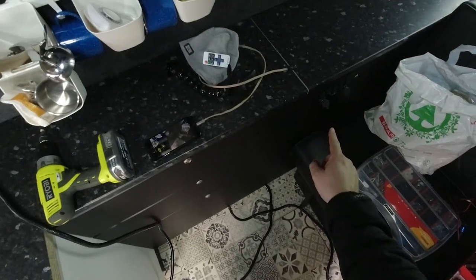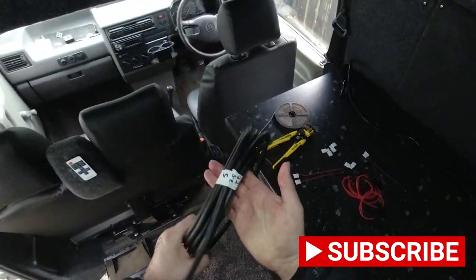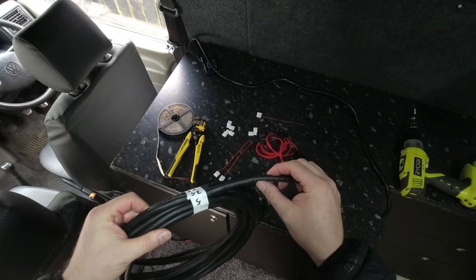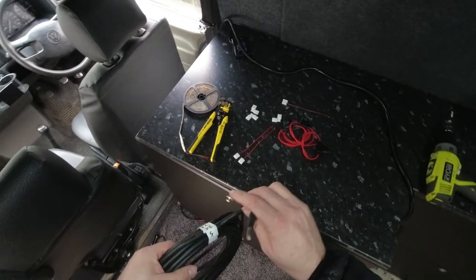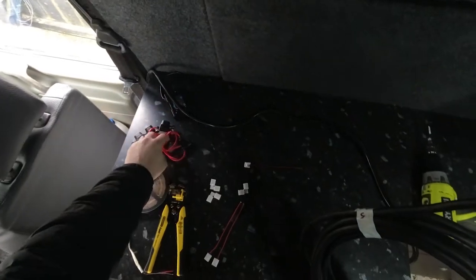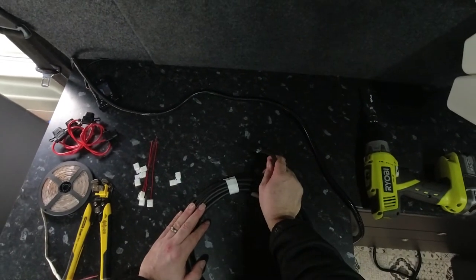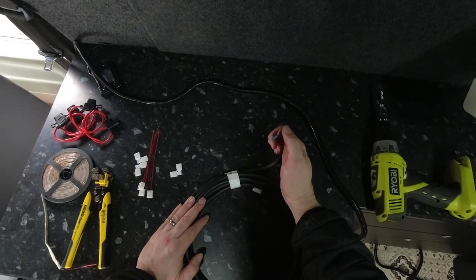So the main job first is to get this marine panel wired up. I've got some heavy duty cable ordered online - it's two times 2.5mm squared, which is heavy enough, flexible core twisted. You don't want to use solid copper wire because with the vibration of the van it can turn brittle and break it - and that would be a whole headache trying to find where that snapped. So the first thing is I'm going to trim the negative - I'll use blue as neutral and brown as the live.